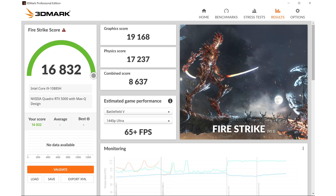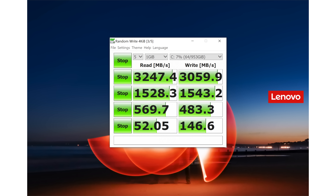We got a BIOS update and I thought maybe it was going to tame the fans a bit, but no, it didn't. If you're just sitting doing a Word document, the fans won't bug you, though you will hear them spin up occasionally. When you're pushing it hard — using Blender, doing AutoCAD work, or Adobe Premiere for video editing — there's plenty of noise. When using demanding programs, it's not a whine, but it is one serious whoosh of air. It has two fans and a decent number of heat pipes, though the thermals are challenging.